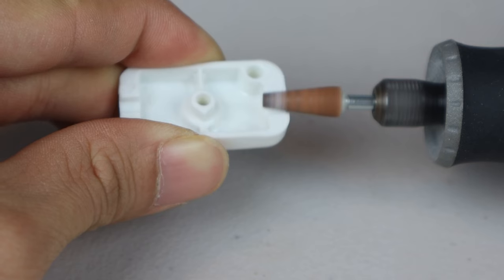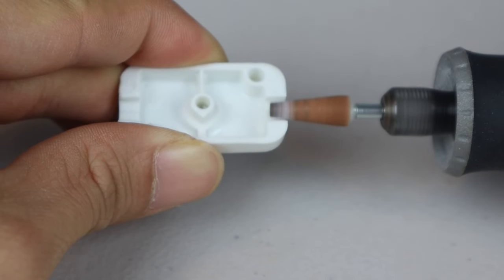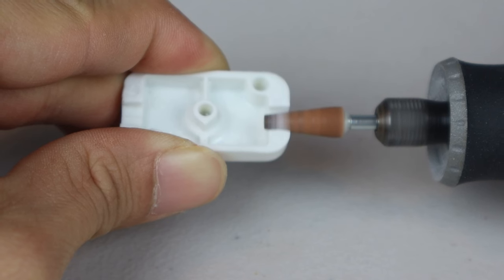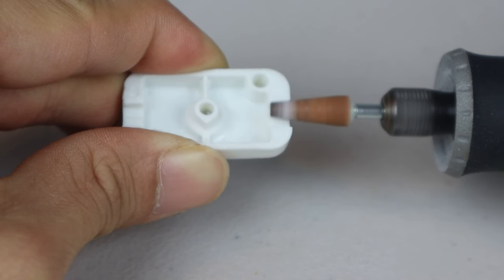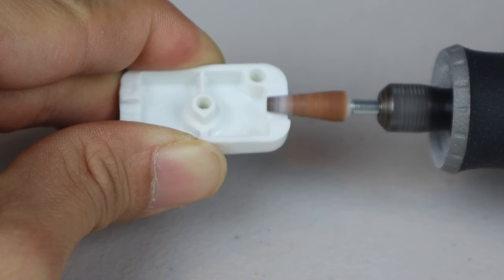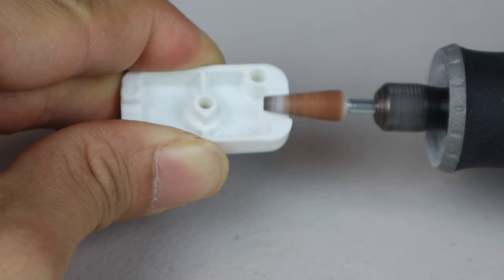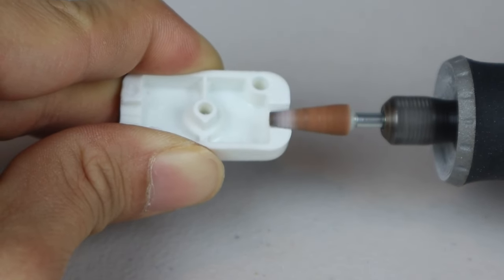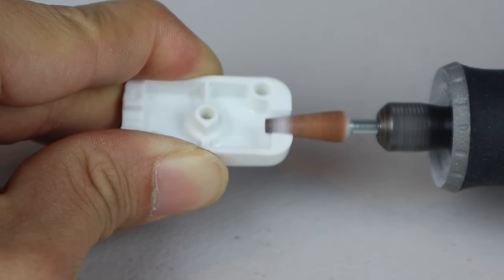While I don't recommend this, I did end up modifying the switch housing to accommodate the thicker wire by drilling the opening larger with a rotary tool. Just a disclaimer that this may not be appropriate in every case and could create potential for electrical shock or fire hazard while using the switch — so do this at your own risk. I did have to be certain that I widened both sides of the slot so that the spikes would pierce the correct wire, and only that wire.